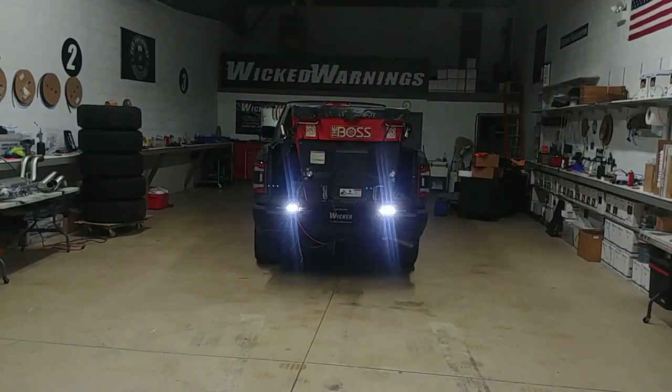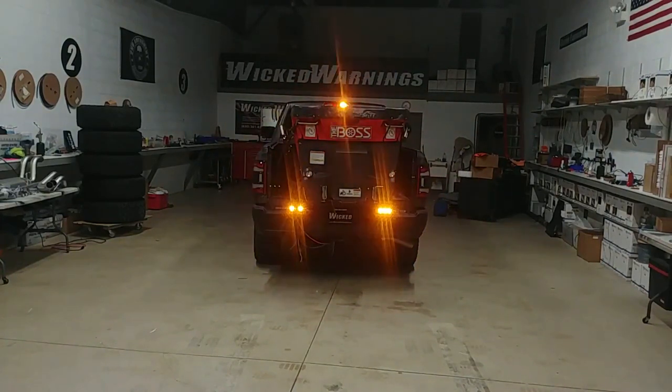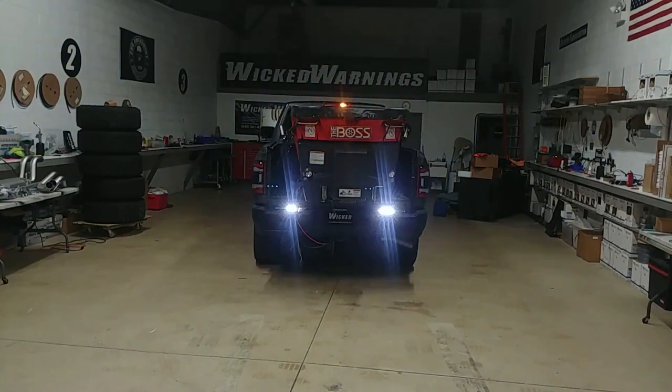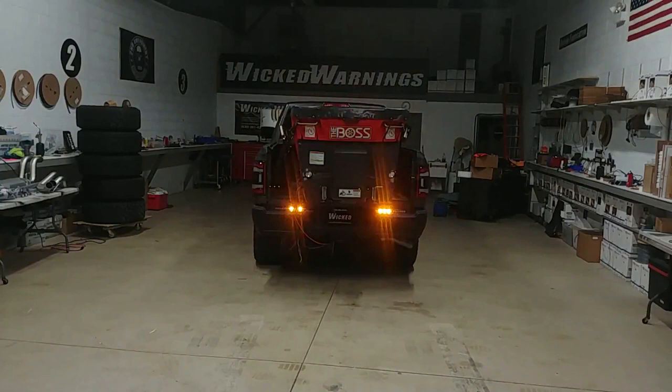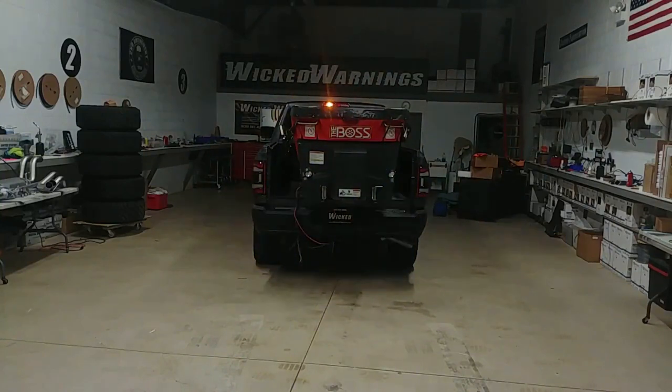Around the back, as you can see, we are tailgateless through our winter mode and this does have all LED tail lights. What we're featuring is our Thin-X strip in an amber-white alternating pattern. We've got a pair of them synchronized, mounted right on the bumper plastic with VHB tape, and we ran the wiring through a quarter-inch hole.